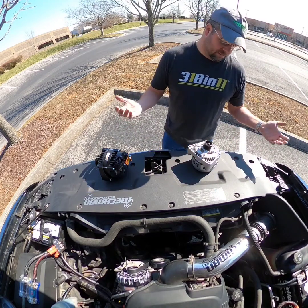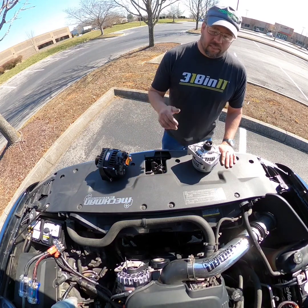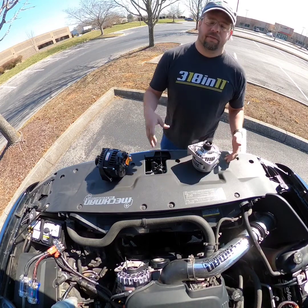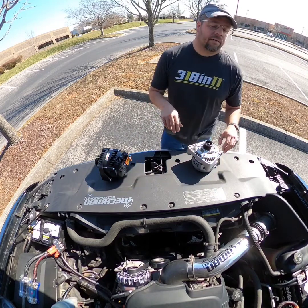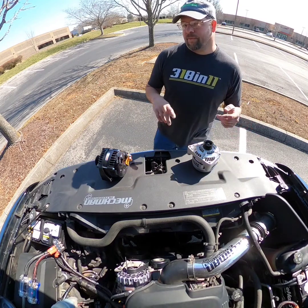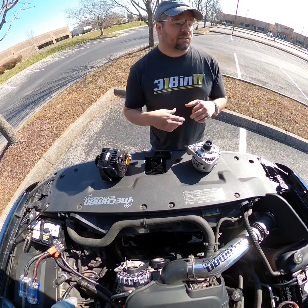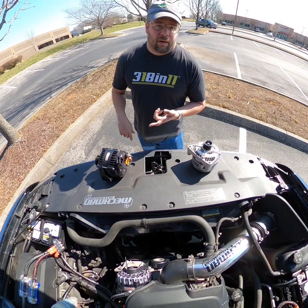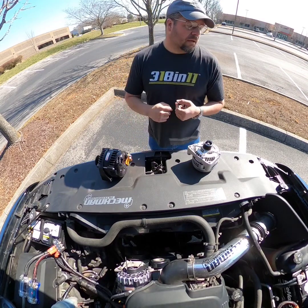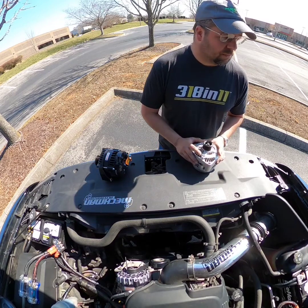It's not bad — this works perfectly in the right environment. There is no perfect alternator. The coyote motor Ford Mustangs used a small case style from 2011 to 2014, and then in 2015 they switched over to the larger case, likely because the computer and electrical demands became more powerful.